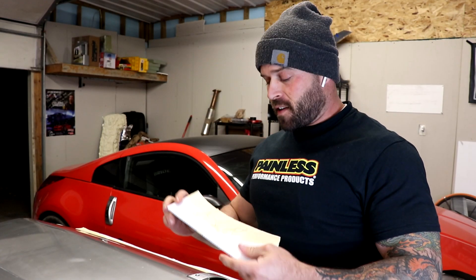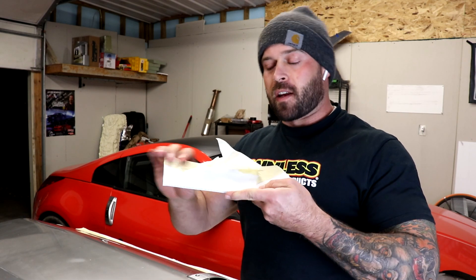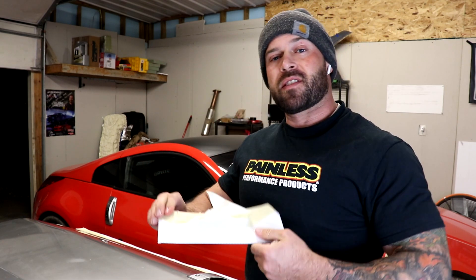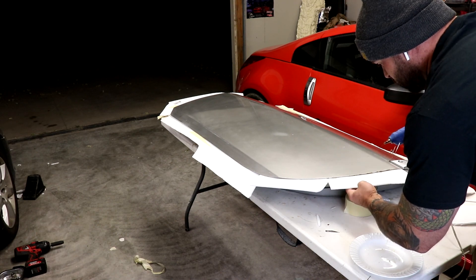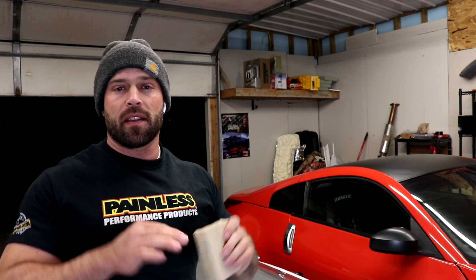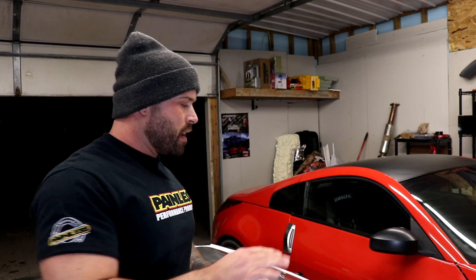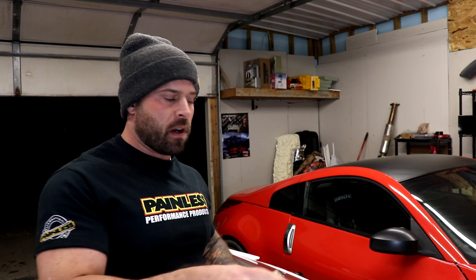Now that we've made all our templates, we're going to remove the masking tape and hot-glue the signboard underneath the door to give it a border for the gel coat to sit onto. Now that the signboard has been fitted around the door, I'm going to take this wax and fill in any gaps so the gel coat doesn't sink in and prevent me from taking the mold off. I'm also going to cover the door handle with it because the gel coat won't stick to wax, creating a negative space for the door handle since I'm not using that in this mold.